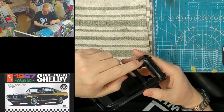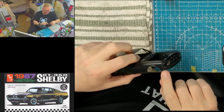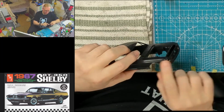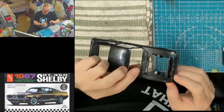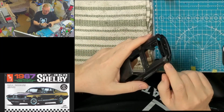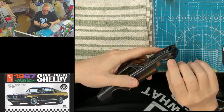Again, I just went in from behind so that down in here, I just filled it in. So I retain my panel line, so I can sand this all I want and we're still going to have a nice panel line there. All I need to do is just get it kind of straight and flat and smoothed out so that it's not a lip on there.